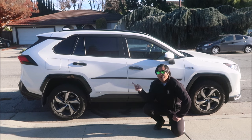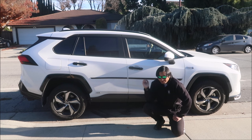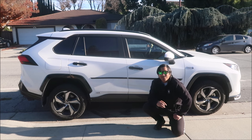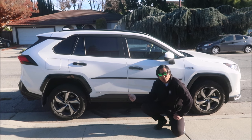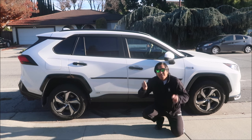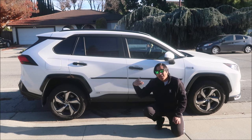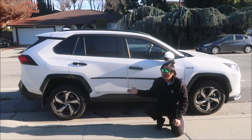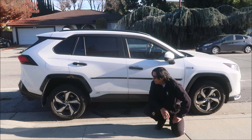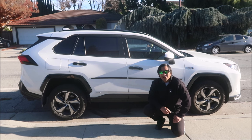The rear is really harsh — when you go off speed bumps it crashes really hard with a big thunk. That's the only thing I notice; other than that it drives pretty much like it did before. I do notice it has more oversteer than before. With the sway bar installed it was more neutral, but now the back slips out a little more. That may be because I didn't get a wheel alignment yet.